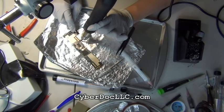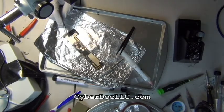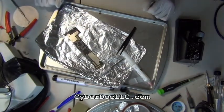The plastic on a logic board melts above 250 degrees Celsius, so at 200 degrees you're safe. This actually also works if you only have a hot air blower or a regular hair dryer and don't have a heat gun, because the alloy I used will melt at 57-58 degrees Celsius, and a regular hot air dryer goes up that high if you use low speed and high heat.